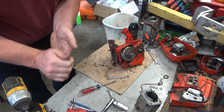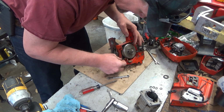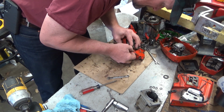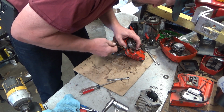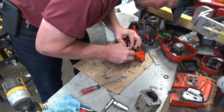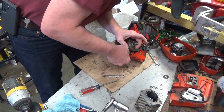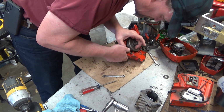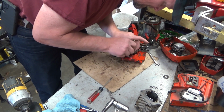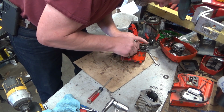I am virtually certain that manual oil pump wouldn't have been doing a diddly squat. Okay. So you move the line back in the grommet within reason and almost get there, and then you just kind of gotta force it over. Just bend it as little as you possibly can, and then you want this to thread on easily. Cross-threaded, you should know it, because it should get tight awful quick.